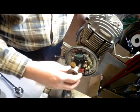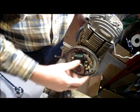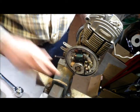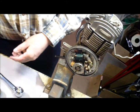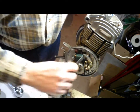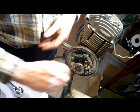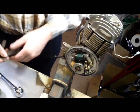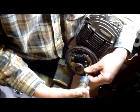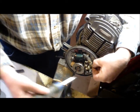That's where you want your spark to happen. But before we make the spark happen, we want to make sure that we have the right gap. And to get the right gap — now this is nice and loose on there — you want to rotate that cam until you see the points widest open. Right about there. You want to find your feeler gauges, and you want that gap to be between 0.3 and 0.4 millimeters. So I'm going to grab that 0.35 and shove it in there. That's going to take a little bit of work to open her because 0.3 is also tight. So what we do is we'll loosen up the screw that ties her down, like so.